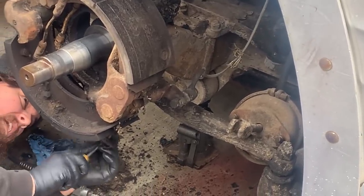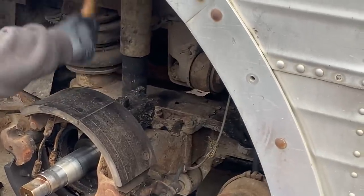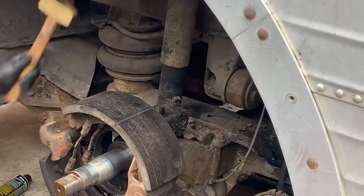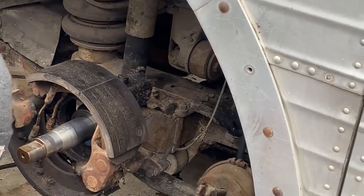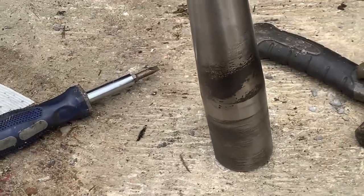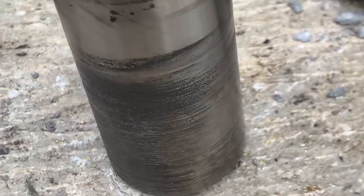It is cold - it's 32 degrees out right now. It doesn't appear to be moving. So this is the bottom bushing - he pulled it out by hand before we even started taking the kingpin out. It's obviously worn through terribly. We did knock the tapered pin out - we were trying to do it with the baby little brass sledge hammer first, then just took a couple blows with the big one. It basically fell right out once it started moving, but it's severely scored and it's torn up.